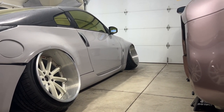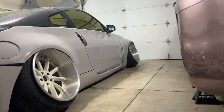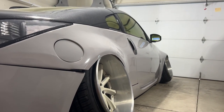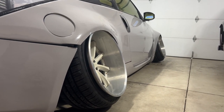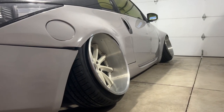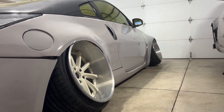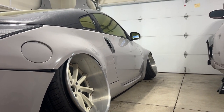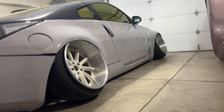It'll probably be lowered back down regardless. In the front, it's going to have to be raised — the whole wheel is tucked pretty far. About two-inch spacers will be needed to pull the wheels out so the fender sits correctly. Rather than raising it though, the fender will probably just be cut more — radiusing the fenders upward visually raises that area without actually raising the car.